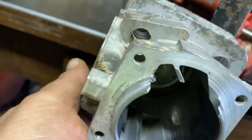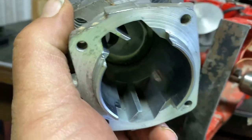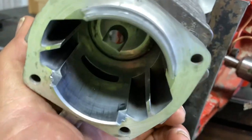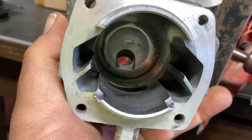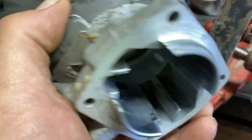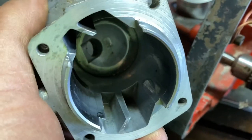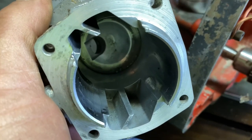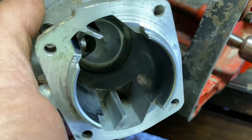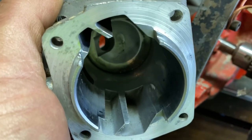You have to see if the transfers can feed the engine at those RPM. As horsepower increases, you need a larger volume of fuel in order to create that horsepower. How do you get a larger volume of fuel through? Some people will increase the duration of the transfer by raising it, but it is typically better to go wider first.